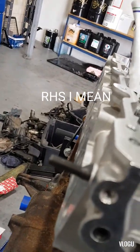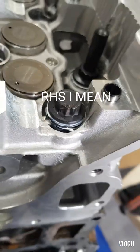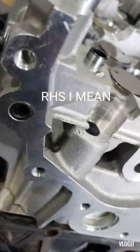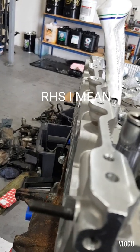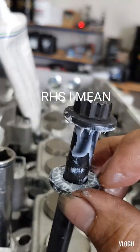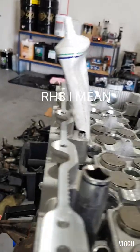This motor assembly grease covers all purposes — engine rebuilding, rust-proofing, brake assembly, and steering gears. It's applicable for all those gears. The same thing applies when you assemble the head bolts: you also have to put some grease on them so that when you tighten the bolt it will not scrape the surface of the cylinder head. Even though there is a washer, once it's turned it will scrape and affect the tension of your torque range. Put lubricant on the upper washer facing the head bolt as well.